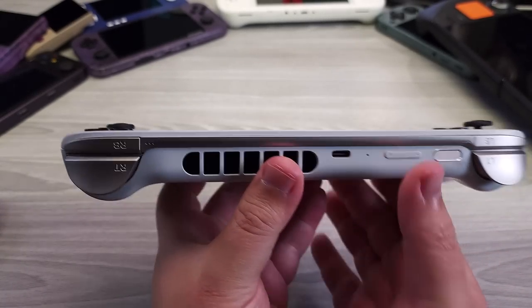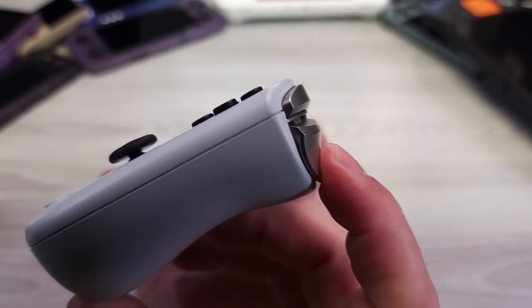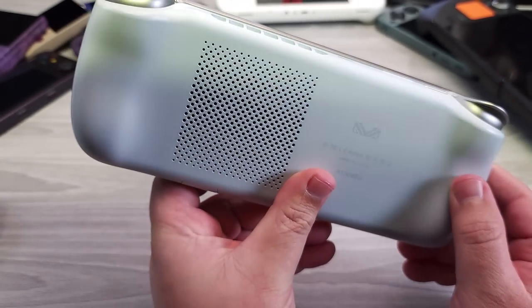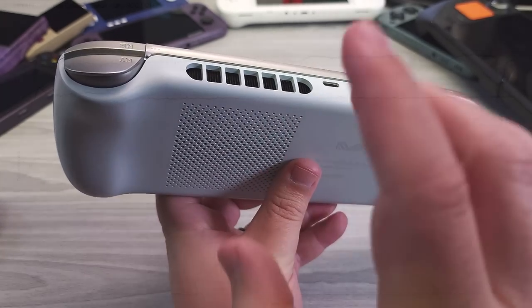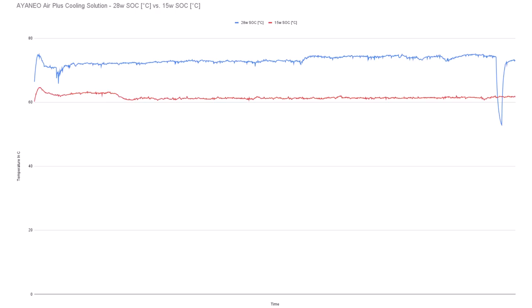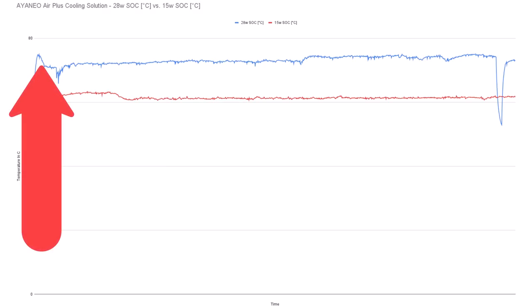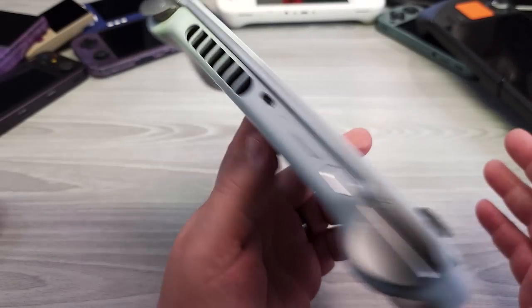Going along the outer side, we see the analog triggers — these are honestly a thing of beauty, probably one of my favorite analog triggers to date. The amount of tension, how they feel, and the complete accuracy — you will not hit 100% of the range until you fully bottom out, and it's perfect every time. On the back we can see the heatsink and fan. At 15W, we're comfortably under 70 degrees Celsius the entire time I had the bench running. At 28W, it's comfortably under 80 degrees Celsius, mostly hovering around 76 or 77 degrees — completely fine for this device.